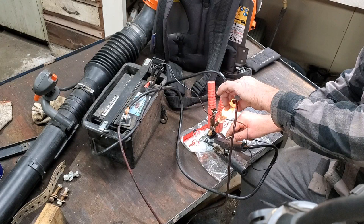Now let's switch over and talk about a three-post. This one you ground here — the three-post grounds from the actual mount. So we'll ground there. We'll hook positive on this terminal and it doesn't matter, same situation. And then we're going to hold our test light on here. I'm going to hook the jumper up to positive and we're going to touch here just like I'm turning the key on. That's all it is — it's just a switch folks. So I hope this helps you guys out and let's get this solenoid popped on right quick and see if we can make this machine come to life again.